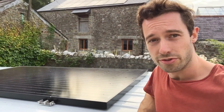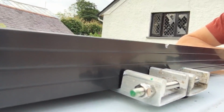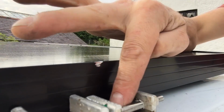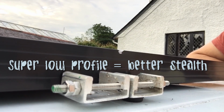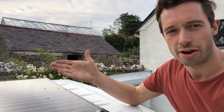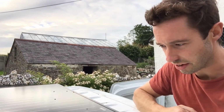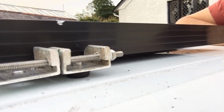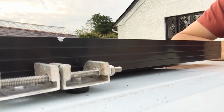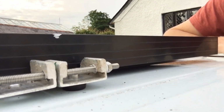I have also put on the solar panel. I made a hinging bracket, which is attached by one bolt and the other one's a hinge, and that means that I can essentially lift the solar panel up only one way if I need to, if maybe in winter it's not getting enough light, but hopefully it's tight enough to the roof. And underneath you might just be able to see I put some rubber tap washers just to make it a little bit more deadened with movement and things.